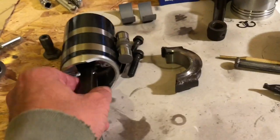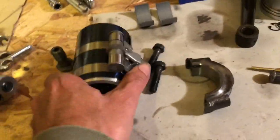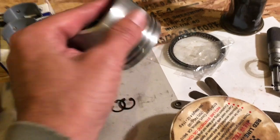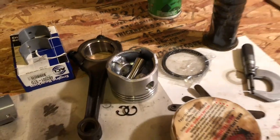Assembly going pretty nicely. We've got full floating flat top pistons — we've talked about this before. Let's take a quick look. These are the Australian Russell 68mm, about 135 thousandths overbore on our little 998.